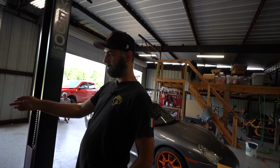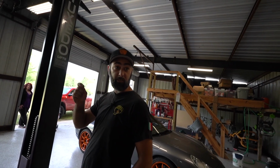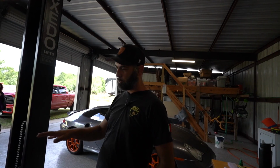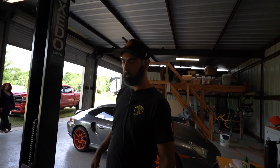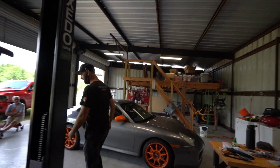We're gonna pull the plugs and do a compression and leak down and some other stuff. Yeah, because that's how you service a 355. So we don't want to run it for too long and get it too hot. We want to warm it up before you do compression and leak down, and we want to check some parameters, but we don't want it smoking hot. So we're going to try to be pretty time sensitive with that process.